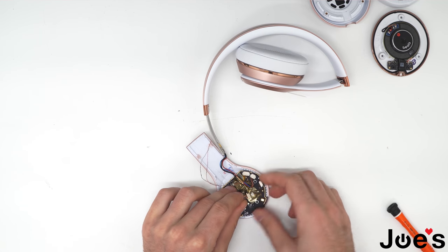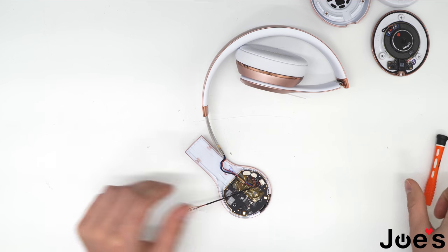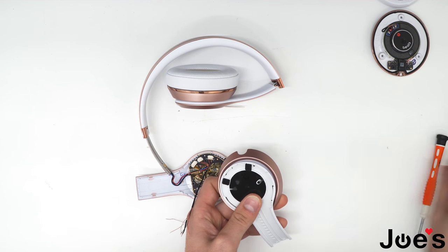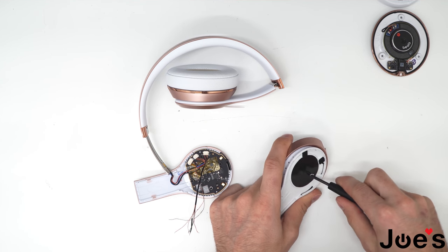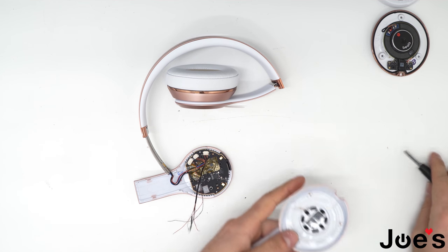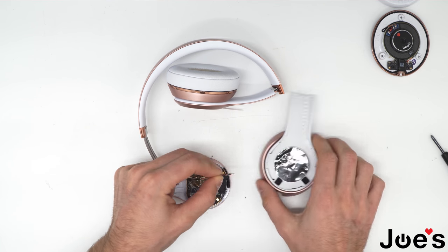Let's go ahead and plug this in, just like that. What I like to do is widen this hole here where you're going to be putting the wire through, that way it has more flex and room to wiggle around when you're folding your headphones. So go ahead and do that with the screwdriver — just poke a hole through it, just widen it up a little bit. Now we have a little bigger hole; doesn't have to be too much bigger. That works. Let's go ahead and put these wires through.